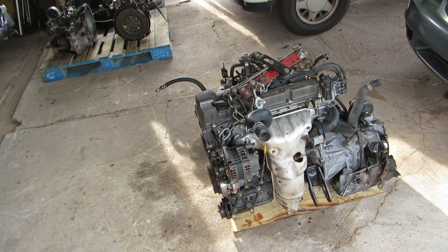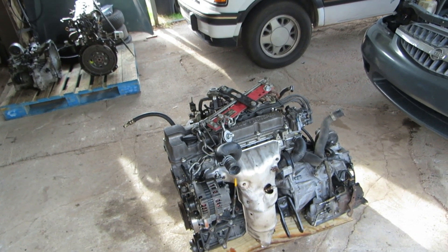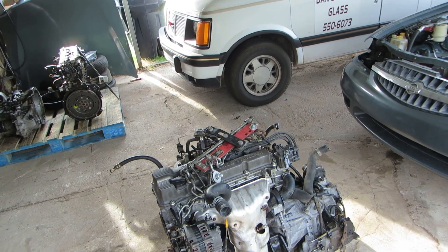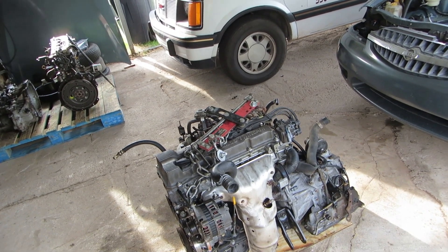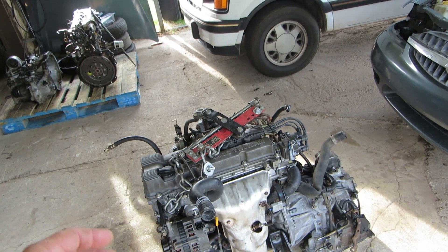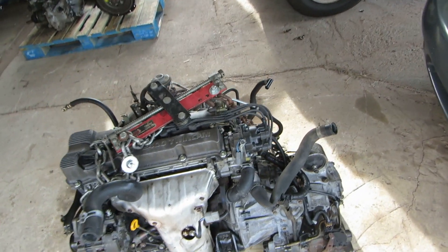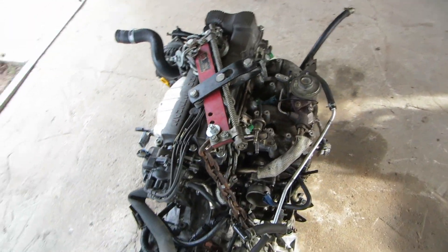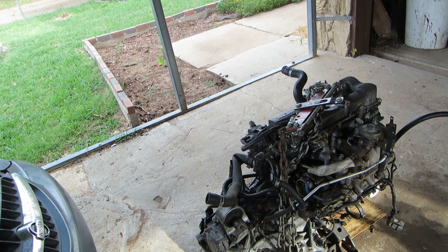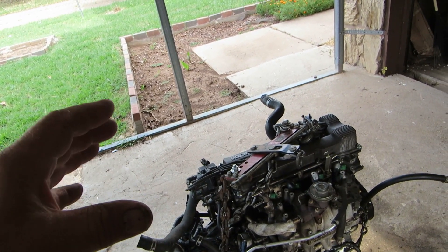Here's our unit — we have it completed and we've checked it all over. You need to walk around this engine two or three times after you get it done and make sure every nut and bolt that you touched is tight, every piece on it is correct. That kind of stuff, because you don't want to go into it again. It's very important that when you mate the transmission to the engine, you turn the engine over to make sure it's not stuck or binding. When I chained this up, I had it chained so it would not rub on anything.